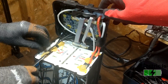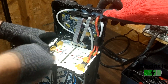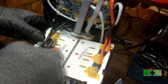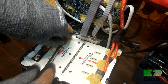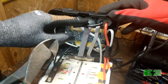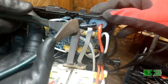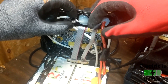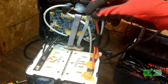I'm using a flat head screwdriver to get all the putty off the discharge terminal, and I may have to do this to all three of these connections. Next up we're going to take our snips and cut the negative black cable at the top. Try and cut the cable as close as you can to the heat shrink that's already on there so you have more slack for your bypass cables. Make sure you're watching these cords — you don't want the cable you just snipped touching the positive end or you're going to have a fire.